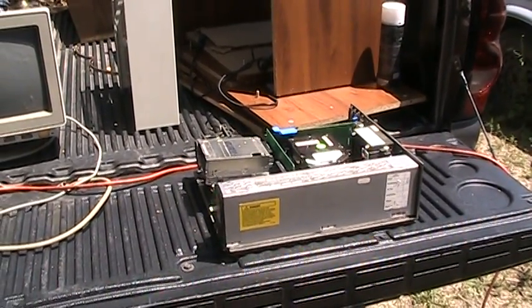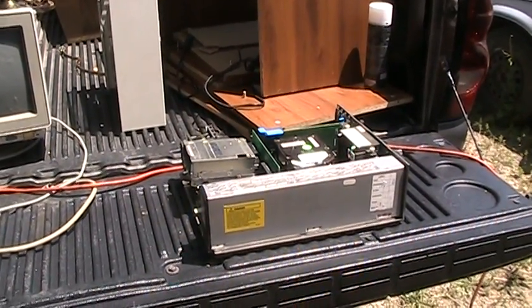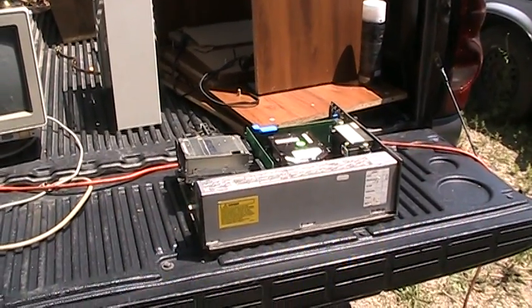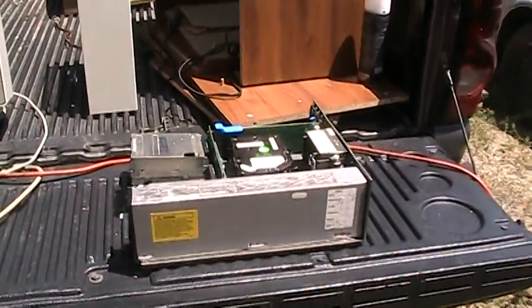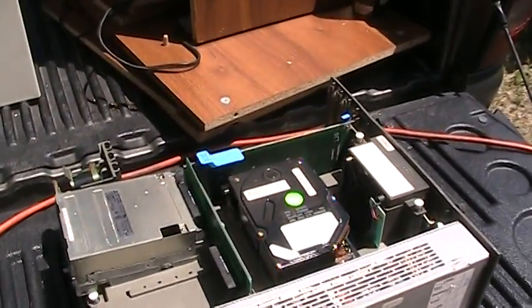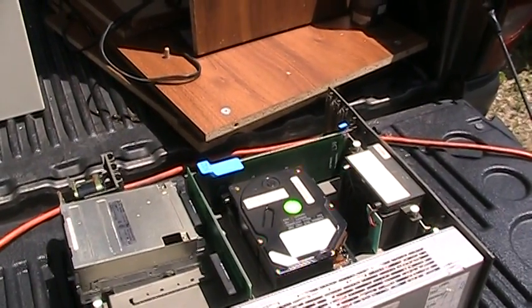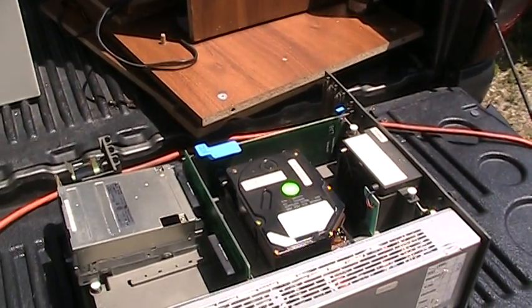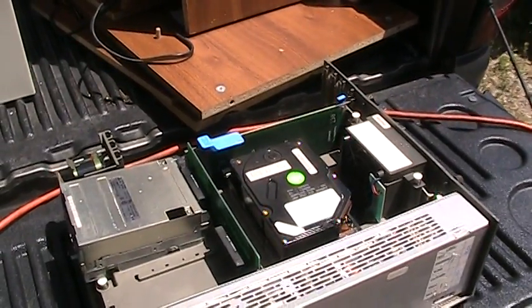I have noticed a certain amount of disappointment being expressed when I say 'smoke test,' which really began as just a silly little joke and that's all it's ever been meant as, and there isn't any actual smoke that comes up. Well, maybe in this particular quick video we'll be changing that, because these IBM PS2 computers have tantalum capacitors installed in them that sometimes short out, especially if they accumulate moisture, and they usually explode in a fairly dramatic but ultimately pretty harmless manner, especially since most of them are bypass capacitors that aren't strictly necessary for the design of the circuit to function.